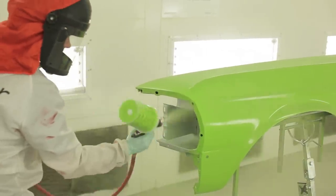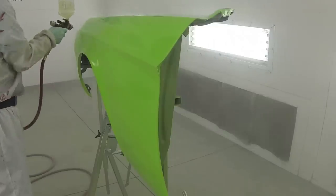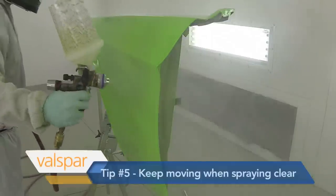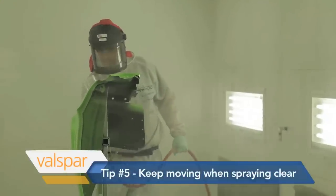If you're going to paint a car, you're going to get a run. I hate to say that, but even I get runs too. But the big thing is, once you pull the trigger on clear, keep moving. Don't stop. If you stop, either let go of the trigger or pull away. If you stop in one spot, you're going to get a run — you'll load it up.